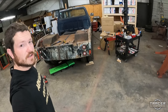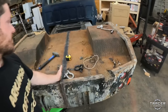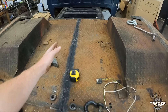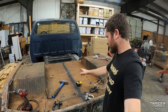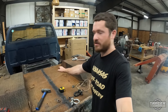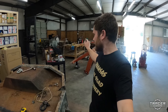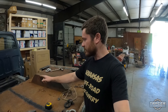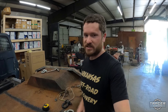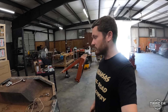The bed is completely bolted on. Now we've got to move over to the boom. Because we took about six to eight inches out of the middle of the bed, these wheel wells are now closer together, and the angled brace of the boom fits right in between those wheel wells — so I've got to narrow that piece so it will fit between them. There are three bolts that go through here; the middle one is the same and the holes through the frame are the same. I'm going to drill out the middle one, then measure from it each direction to figure out how much to cut off both sides. I'll go underneath, drill up through the center one, then measure, mark, and get the ends of that angled piece cut off.